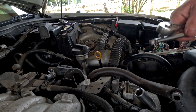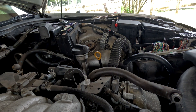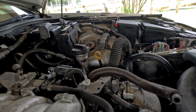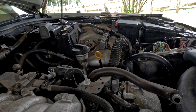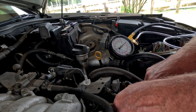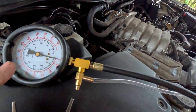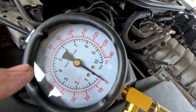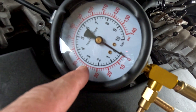This car came to me just to test it. Gravity is still working — that's kind of positive. We've now got the little fitting on, we need to get the gauge. Fuel pressure gauge — look at this. They're awesome. I'll show you the set I bought. We're going to put the wiring out of the way and slip this in here. Let's fire this thing up. I have had some issues with some leakage over there — first time I've used this particular gauge and the quick connect fitting was not great. The fuel pressure spec is 44 to 50 psi.